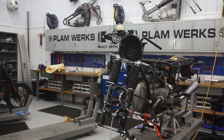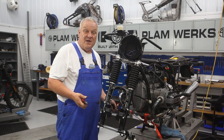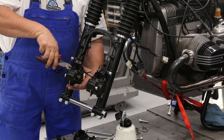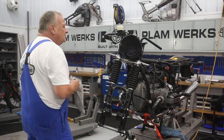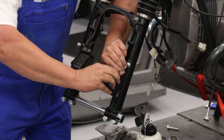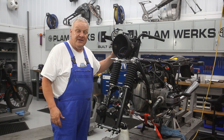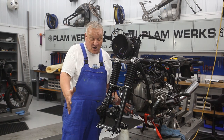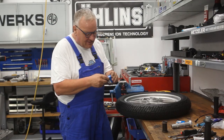The air is out of the brake lines, fresh brake fluid in — just need to button that up and then remove the steel shims I put in as fake brake discs. Putting the caps back on too — two less parts laying around. That's about all we can do on the front end right now because we're waiting for the paintwork. I checked on it the other day — they're doing great and it's going to look fantastic. But we need to take it back apart to put the front fender on, and we can't finish the wiring or do the turn signals until we have the painted fairing back.